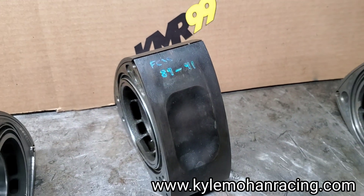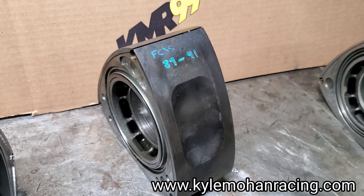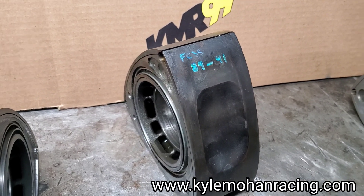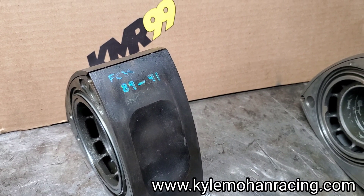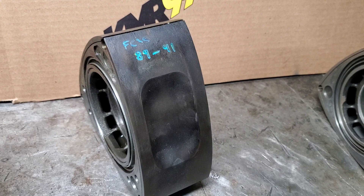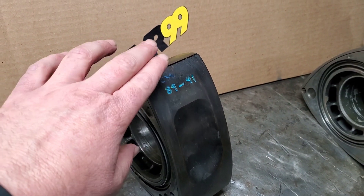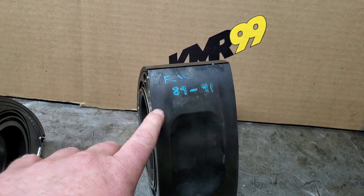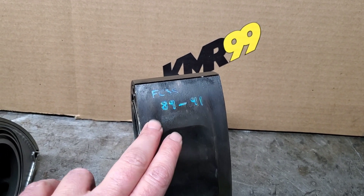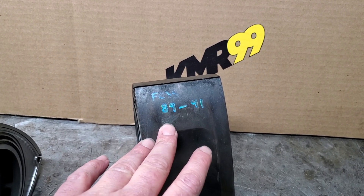As the generations of rotors have gotten newer, they have gotten lighter. Comparing this to some of the earlier rotors that were 10 pounds, we have some weight savings right off the top. To give that in grams, approximately 4,328 grams. Always remember we're using specifications from the original generation of rotors. If you buy a brand new Mazda rotor, I would expect it to be 50 to 100 grams lighter. So you've always got to buy new rotors in pairs, or keep your old rotors in pairs.